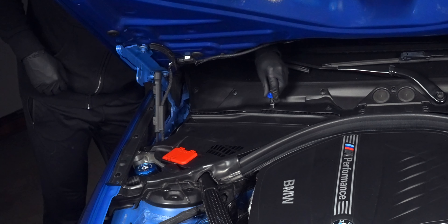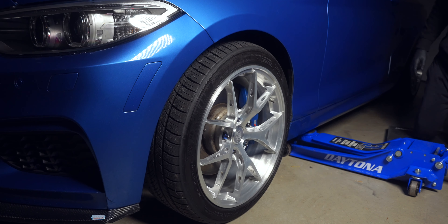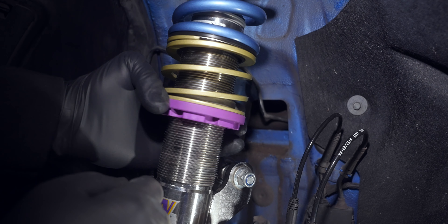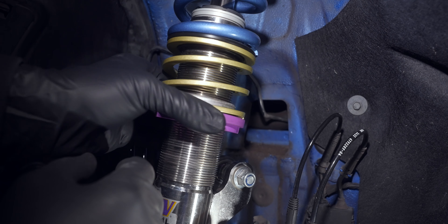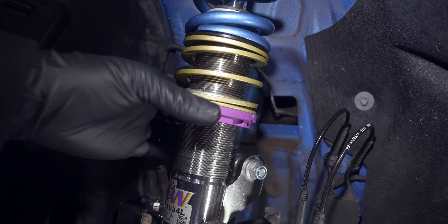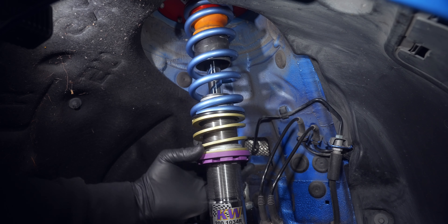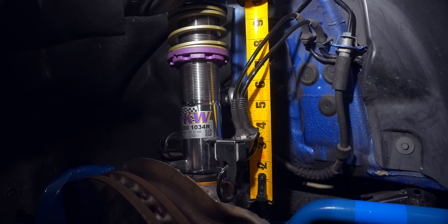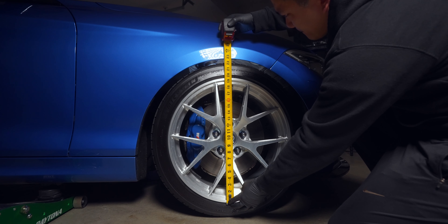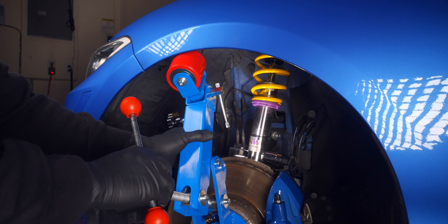Now we can bring in the cowl pieces, lock them into place, then go for a test drive and see how it feels. For adjustments, I prefer to use two jacks as it makes things faster. In total, I went down five spins using the set screw as my indicator, bringing the distance from the perch to the pinch bolt down to about 7.4 inches. You could also go down a half or quarter turn more on the passenger side to account for when you're in the driver's seat. Until I can address the rears, this is fine — no issues with bumpy roads, speed bumps, or driveways. I can definitely tell I have more grip in the front and no more rubbing or clearance issues. From the lip of the wheel to the fender, it's right at 22.6 inches.